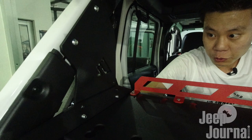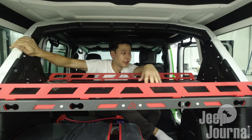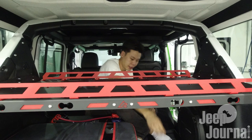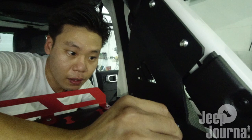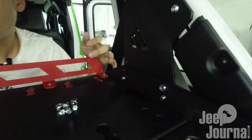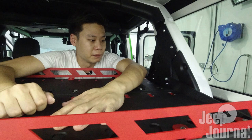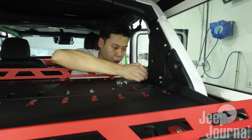All four bolts that are supposed to be supporting this cargo shelf to the roll bar are all in. Now we'll go ahead to use the M8 nuts to start threading them in. Just one - you can put this in without tightening. The cargo shelf is rather solid; I can actually lean my weight on it and it's not shaking much, just a little play so that in case of alignment problems you can still make small adjustments.